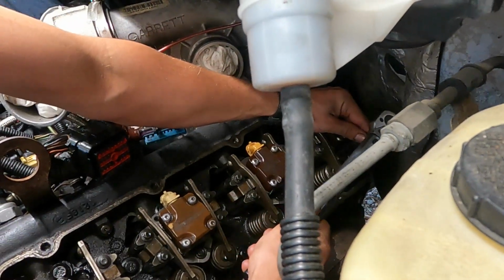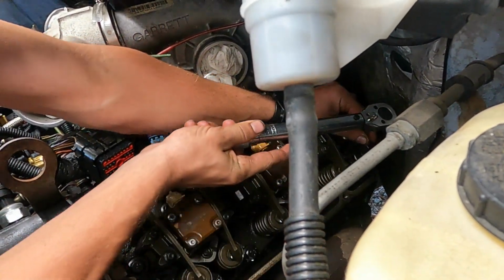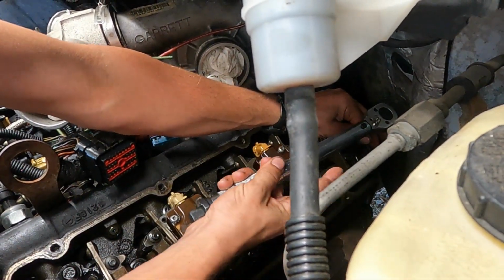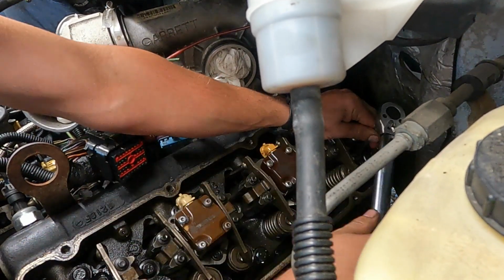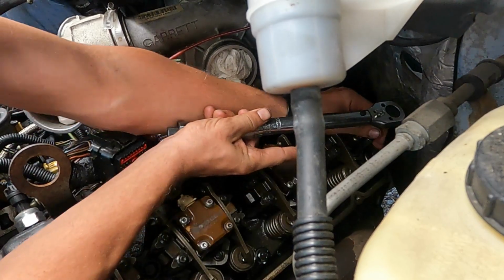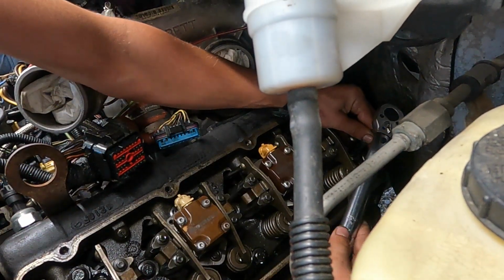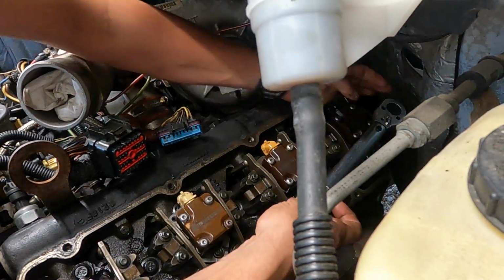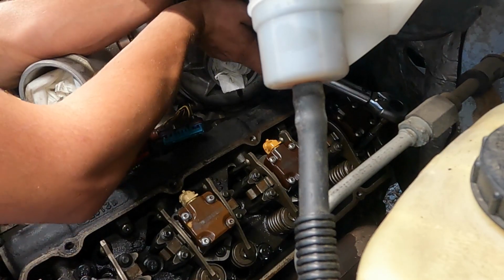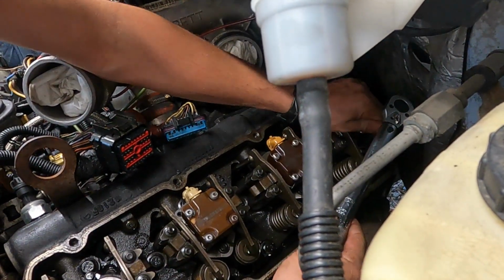So we're over here giving them a quick torque down with the torque wrench to 10 foot-pounds. Just take your time and go slow, because you're pushing the O-rings down, and they may travel a little bit, and it is fine thread on those, so you may turn it a little bit more than you think you're going to turn it, but take your time, go slow. When you get your click, that's it. One click, that's it.